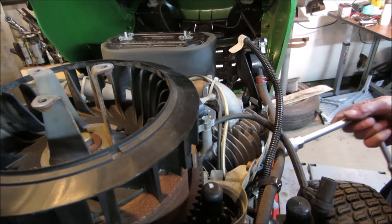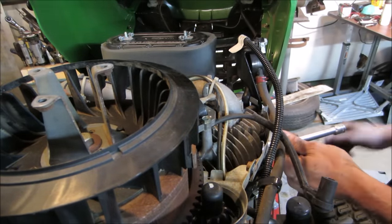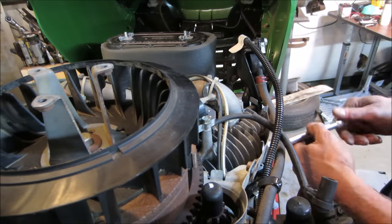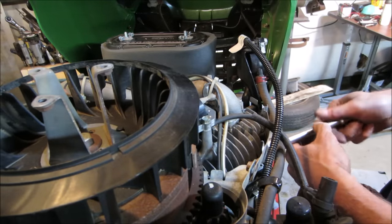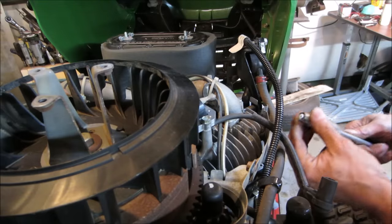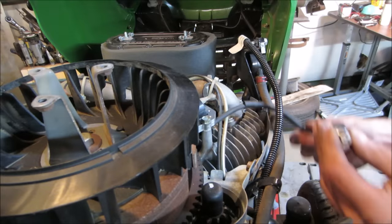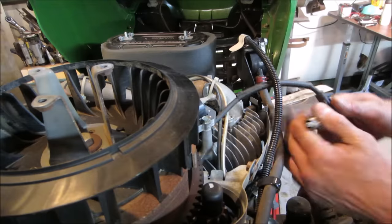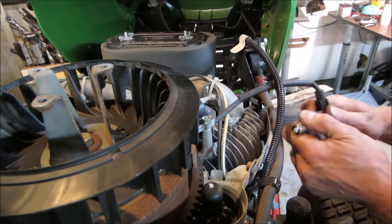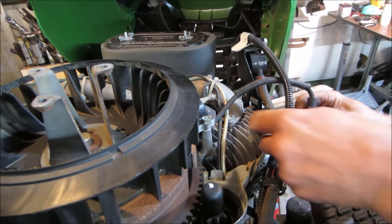Yeah, the DR Field & Brush Mower, it ran on one cylinder. And when I pulled the plugs, you can kind of tell it ran that way for a long time. So it was running poorly. And again, that's why you got to be kind of iffy with stuff that doesn't run. And once you offer, those plugs look brand new. And again, this is an aftermarket coil too, so nothing says that that's going to play well for us.